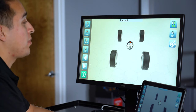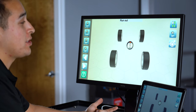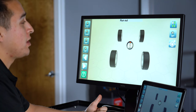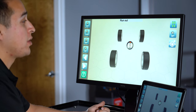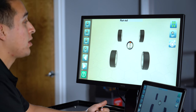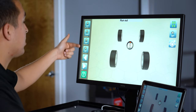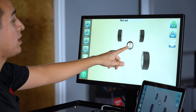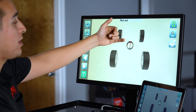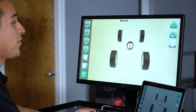This brings us to our runout page. Here we have multiple options — mainly either a lifted or a rolling runout. There will be different reasons you'll have to use either one. The fastest option is a rolling runout, which is only available if you have a four-post lift or a scissor lift. We'll go ahead and show you how to use a ground rolling runout. Using the status indicators on the left-hand side, select 90-degree ground. That'll give us this symbol — the red dot indicates that the black knob should be at 12 o'clock.